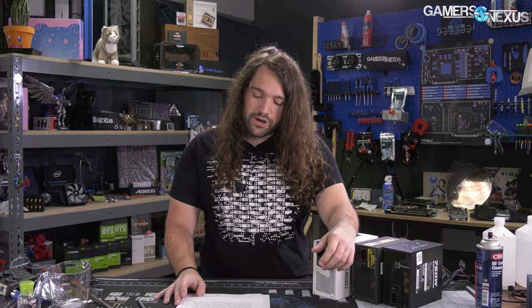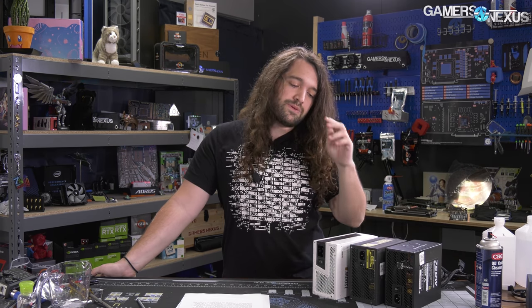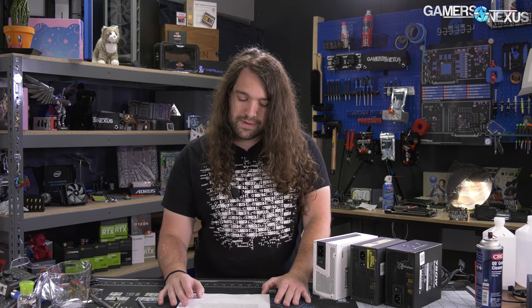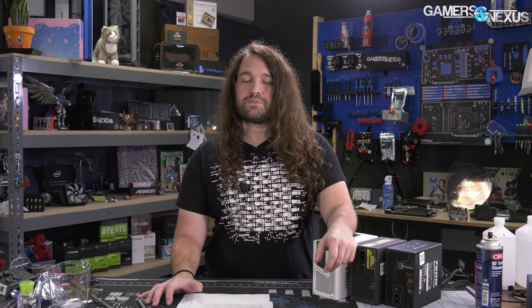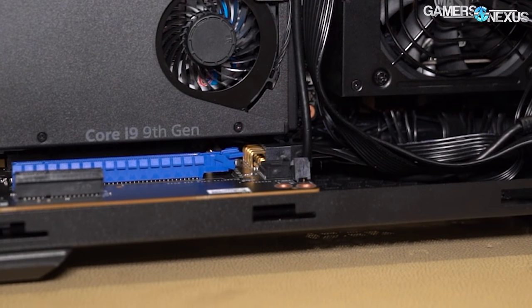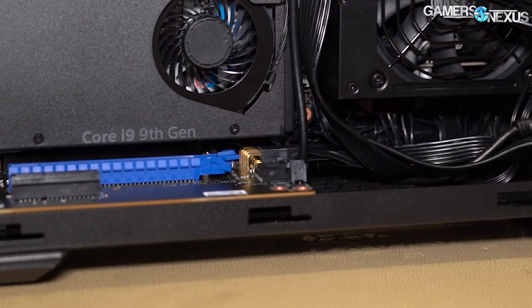Power supplies are expected to generally have a longer span of usefulness than most of the rest of the system. This one on the table is probably something like a decade old now and still works perfectly fine. If ATX 12V0 is ever going to win the hearts of any community outside of people trying to meet CEC requirements for low-end pre-built systems, that adapter problem needs solving. We reached out to a power supply engineer at a large company who confirmed that a 5VSB to 12VSB adapter is possible and already exists, because ATX 12V0 is similar to power supplies that Lenovo, HP, and Dell have for other OEM systems. One could take an HP-to-ATX 12V0 adapter that already exists and re-pin it to make it work.